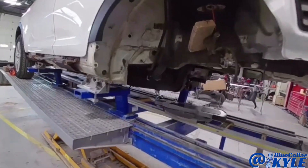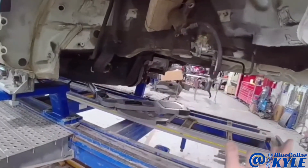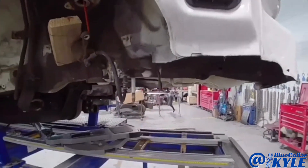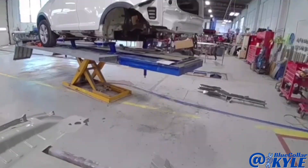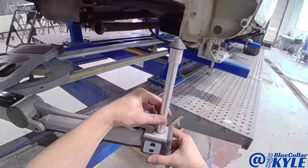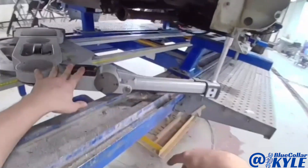I'm going to go ahead and I have our measuring system out here. I'm going to make some measurements just to make sure everything beyond this is within spec. I'll make a couple of pulls if I need to, and then I'll be able to cut these rear sections out. I also have a new rear body panel because I won't be able to get those frame rails in with this panel on there, and this is damaged as well. So I'll make some measurements, then I will start cutting this one apart. First, I have to go to five points in the center section of the vehicle, and that will match the vehicle to the measuring system so it knows where the car is sitting.